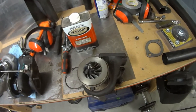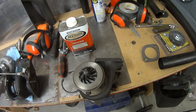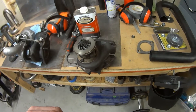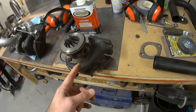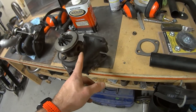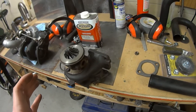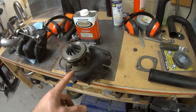I'm going to go through what you should think about when you're clocking, or even when you're thinking about buying a turbocharger. One of the main things you want to make sure when you're installing or picking where you're going to install the turbocharger is the oil drain — you'll want to have that facing down towards the ground.